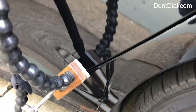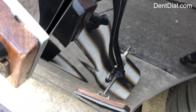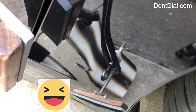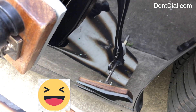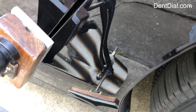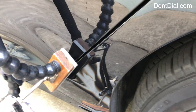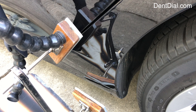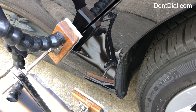Great pull — look at that! Even a great slot bar pull, aluminum just kind of laughs at you. You need amazing torque to pull a body line out of an aluminum panel. So now we're going to really ramp it up, go with a smaller bead inside — it's an insane pull on it.